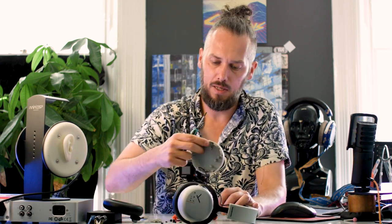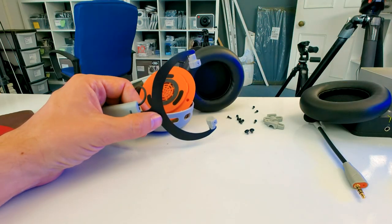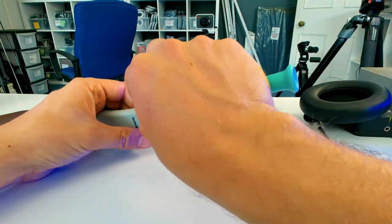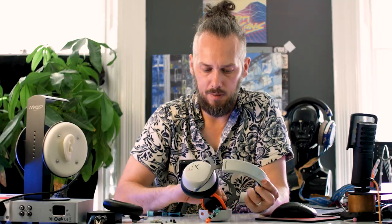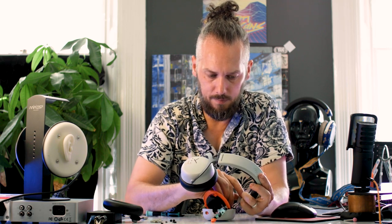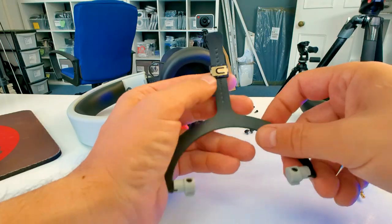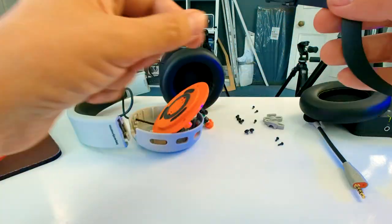Let us see if we can get into the headband. I'm seeing two little screws under here and they look like different screws again to the other ones we've encountered, so we've got three different types of screws so far - these ones have got a flat face which makes them sit flush when screwed in. So that's the actual yoke - that's a very traditional Beyerdynamic part with the pressed steel and indentations in the back. This is also a clicking mechanism - I think it's the same one used in the T70, T90 and a few other models. It's the good one with a spring and a ball bearing in there, quite nice. And you've got a little bit of foam on top so that as it moves around it doesn't tap and transfer sound to the ear cup.